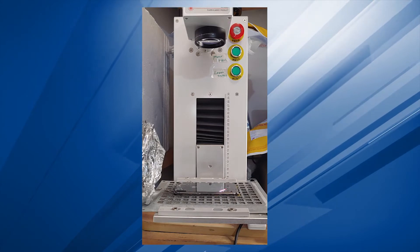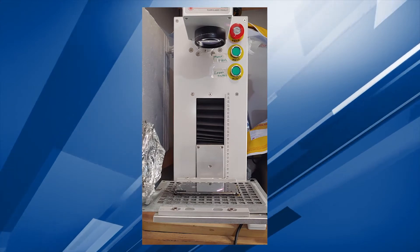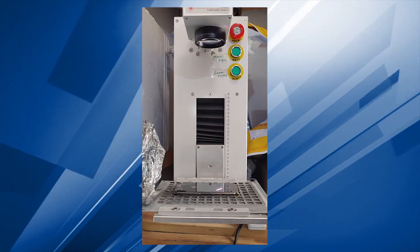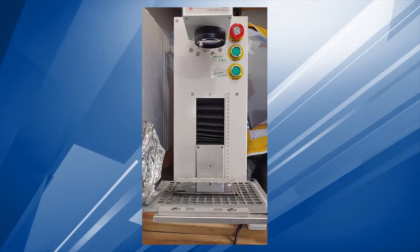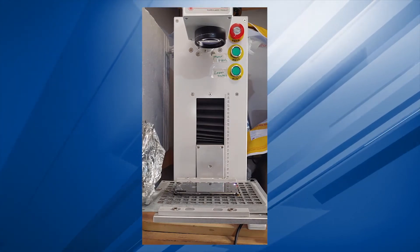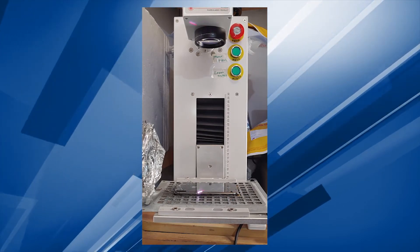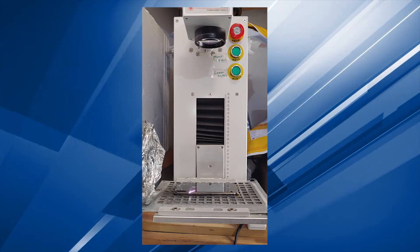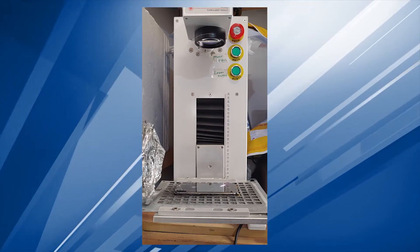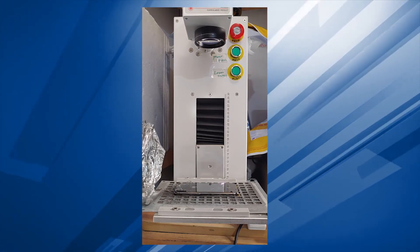We're going to speed it up for the sake of brevity, but you can see the laser etching pulverizing away the adhesives below the glass. This is perfect for those who have slight cracks on the glass. But if you have a lot of cracks on your back glass, the laser will tend to be refracted or reflected to other parts of the smartphone. We don't recommend you DIY this — this is just for professionals.